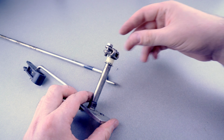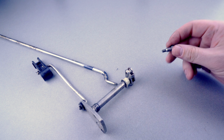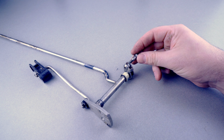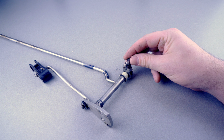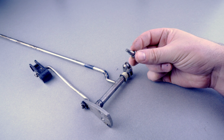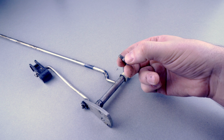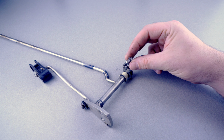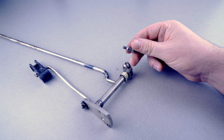It's a little unfortunate. Obviously, it's an easy fix when you're on land. Just pretty much take out the starter, find the pin, and put it in, and make sure it's tight. But this really could be a better design. I'm trying to think of something I could 3D print or something that could just be made. Technically, you could even drill a very small hole into this thread and put some sort of ring or something that you can kind of pull out just to keep it from falling out.